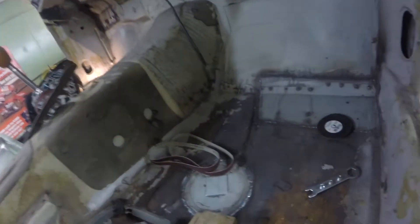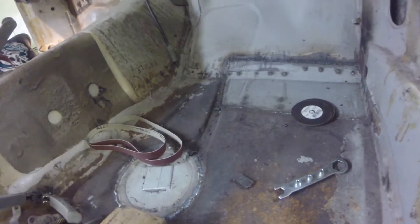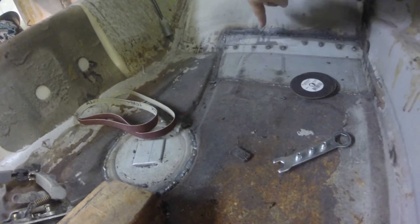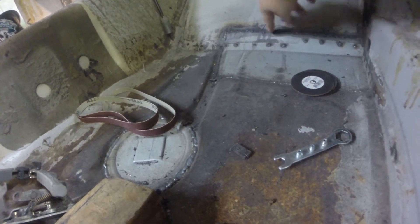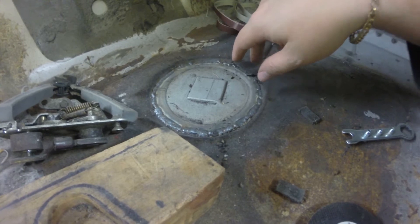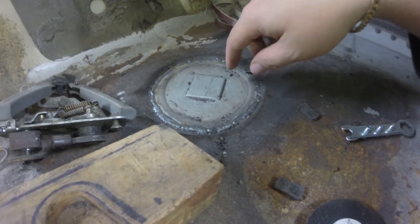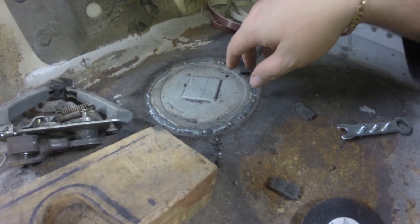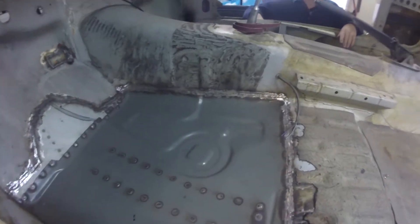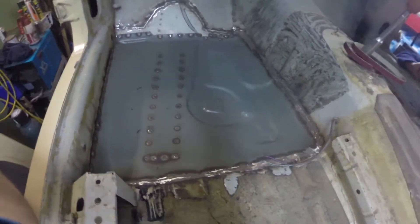Coming to the floor quickly - we placed a new piece of panel here and also the outer skin as that was rotten. We're trying to follow the original design of the floor, which is why there are two pieces made here and not just one folded up - there's one on the outside that goes down and then the inside piece. We welded in this bung which is normally twisted in with tabs banged over, but we've welded it in and we're happy with that. There's a little piece up there that needs tidying up, and you can now see the whole floor pan and the work that was done.